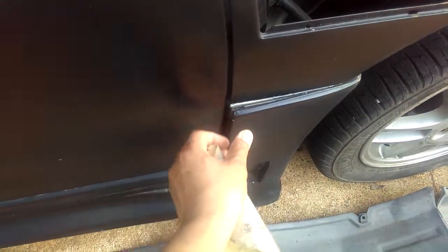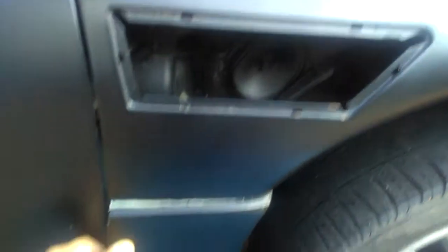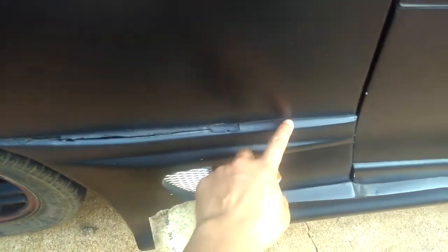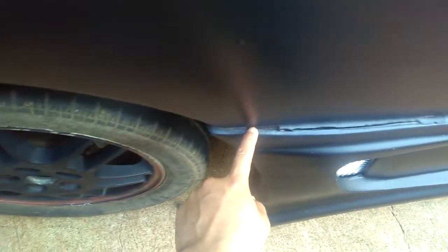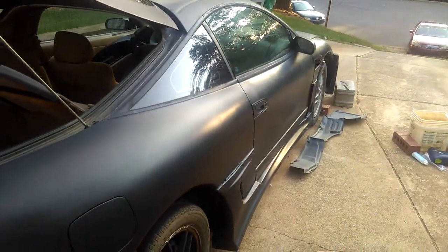Just like my side kits — I need to bolt it in, I need to glue it. They used to use some tape glue inside but I will use some bondo. I had to take it out to work on my car before, so now it needs to be bonded back again. I need to get like a 12-ounce bondo from AutoZone, re-bondo this spot right here — just clean it up, pick it out, sand it with sandpaper before you put bondo on. See the crack right there? That needs bondo. That's how I'm gonna do it before I take it to the paint shop.